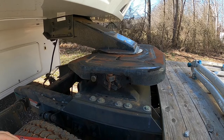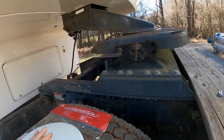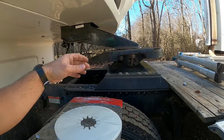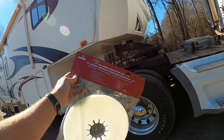If you notice, there's not really a lot of grease on the top surface of this fifth wheel — that's because I run these lube discs, which most people do when pulling like this. The only part that I grease is the jaws. I put enough grease but not too much, because if you put a bunch on there the first time you hook up it all falls out. I grease the kingpin and put some grease inside the fifth wheel on the jaws, and that's all it needs.